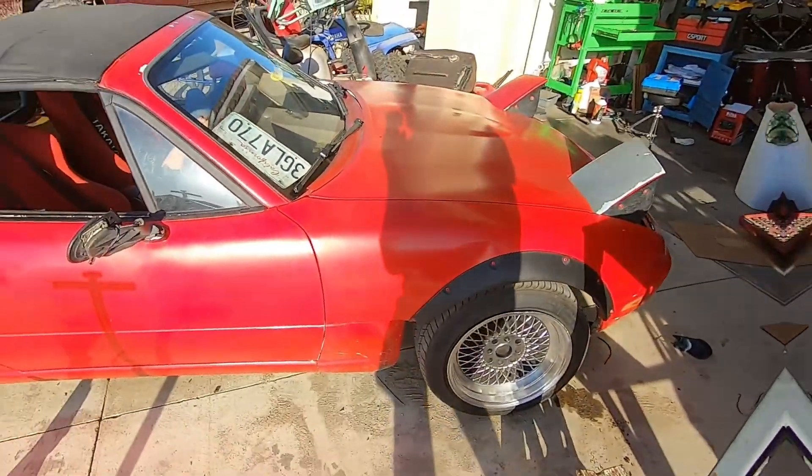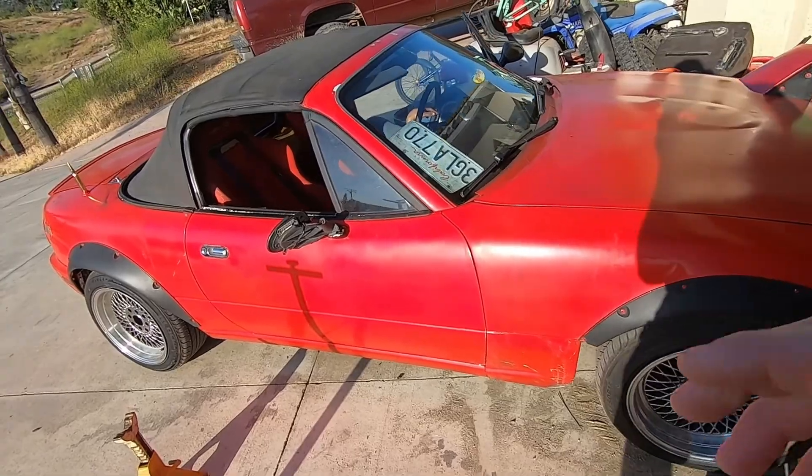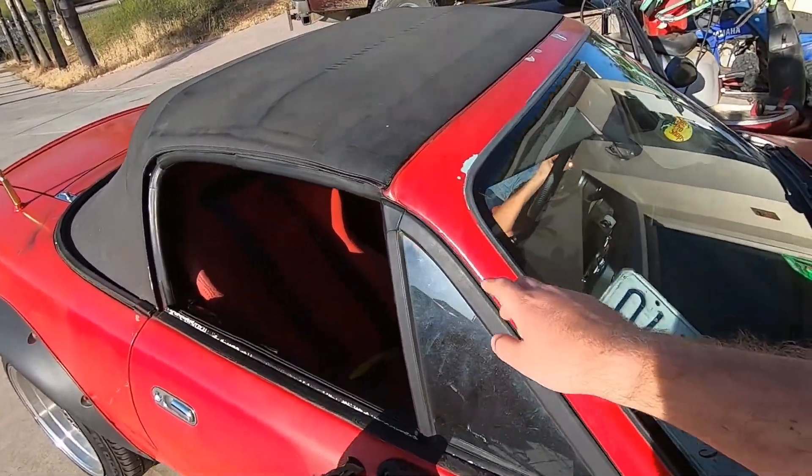Alright guys, first drive for me at least. Clutch definitely needs to be adjusted out, which really isn't that hard - just a couple bolts, just back it out to allow more free play so the clutch engages properly. But car's running good, it's not grinding or anything. Honestly, we did everything right, hopefully looking pretty clean for now. Anyway guys, thanks for watching, leave a like and subscribe, we'll catch you later.